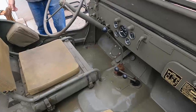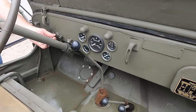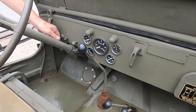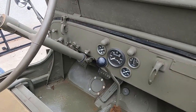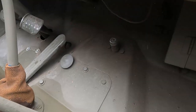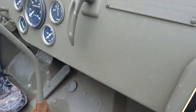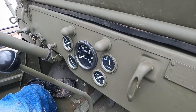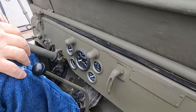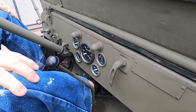And how do you start it? The start is pretty easy. The key doesn't crank it over like an ignition key — it simply turns on the electrical system. I put in an electric fuel pump because the old mechanical ones aren't very reliable. Then up underneath there's a push button — that's actually the starter button. On this model it looks like a headlight; on a lot of trucks it's just a big coil.